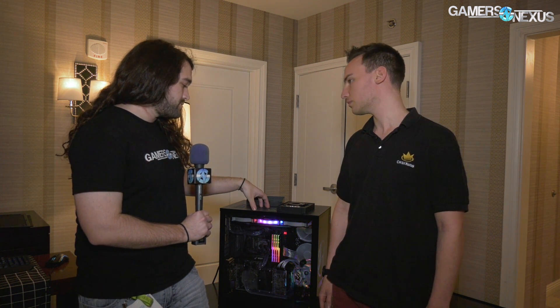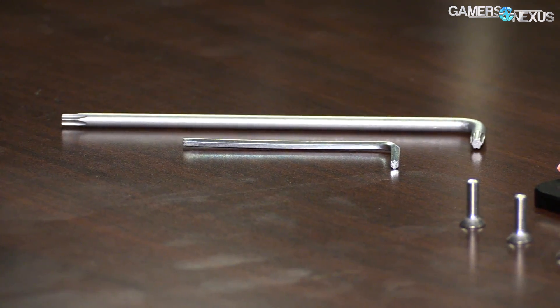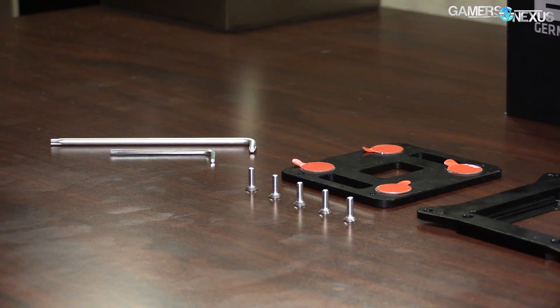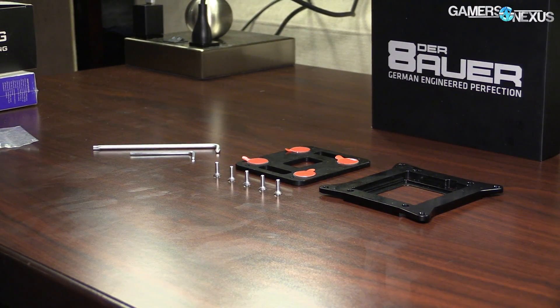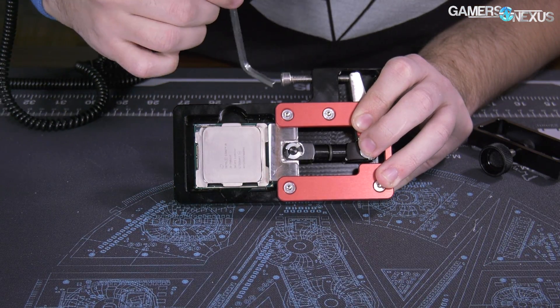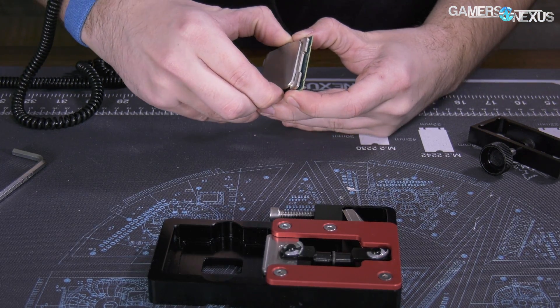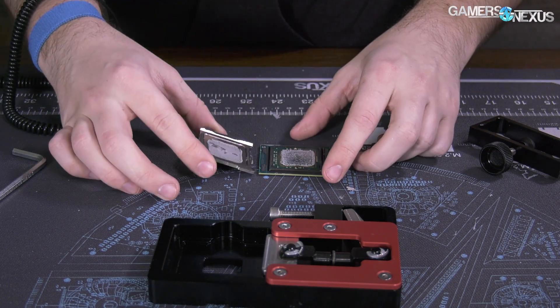The point is that you can allow direct contact between the die and the cold plate. The thermal benefit really depends on the chip — high core count or low core count, and whether it's very convex or not. It also depends on the cooler, thermal paste, everything. Usually it's about 2 to 10 degrees difference. The highest I saw was in a 7980 XE — that chip is very convex, and if you have a cooler that's also a little convex, it works a lot better than using the normal IHS, and that's like 8 to 10 degrees difference.